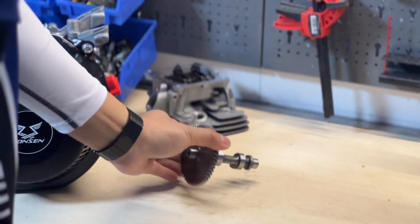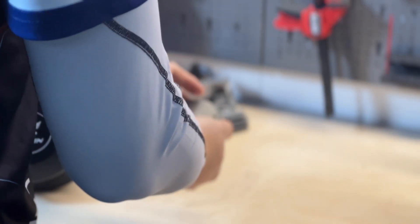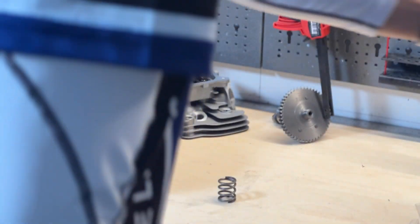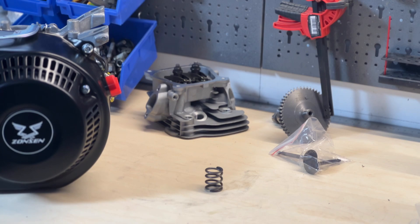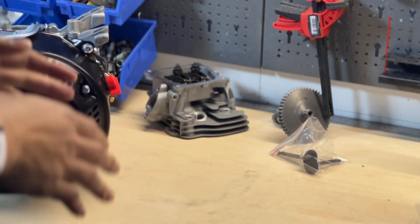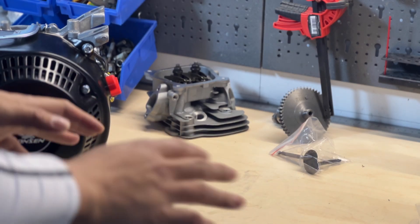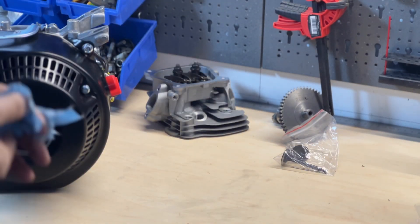The second thing is we're going to use a modified cam — this is a 265 cam — which will give us a lot more lift. Hopefully we'll gain more horsepower in the higher RPM range, or at least throughout the full RPM range, roughly 3000 to 6000. The rockers and springs will also be replaced with higher-performance steel valves, springs, and rockers. The rockers are still being delivered, but these upgrades alone should put us one or two horsepower above the other build already.